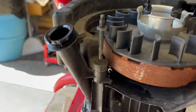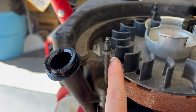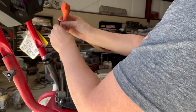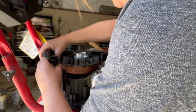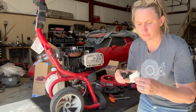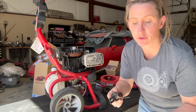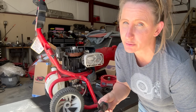Well, this one isn't like the Flathead. Let me show you. Yeah, they can make this one simple and just have it held on with a screw. I have to remove this bolt and the gas tank to get the oil filler tube off. There we go. Oh yeah, that O-ring's shot. Now this is not a normal part of his service, but if you see it, it's something you gotta change. If you do need an O-ring, I'll leave a link to one in the description box below. It is part number 692296.